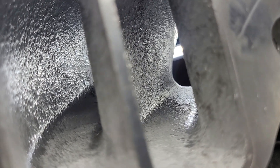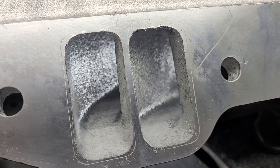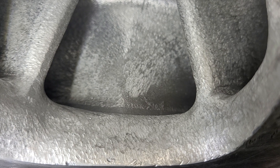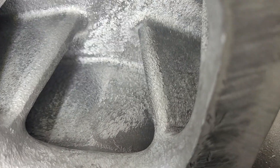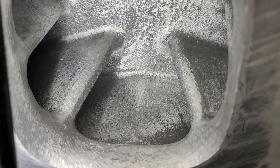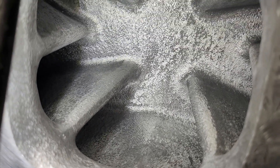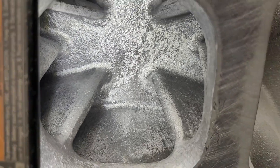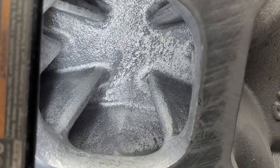That's okay, it's good enough to do a preliminary test between the porting and the radius entries at the inlet. All the entries have been touched up. I haven't gone crazy measuring each one because I don't think they're going to vary that much. I did do my tweaks to the dividers - they still have a sharp edge like they came with from the factory. I believe that sharp edge is there for a reason: the inner runners tend to flow a little better, so you put a sharp edge there to limit their flow a touch.